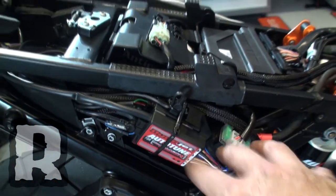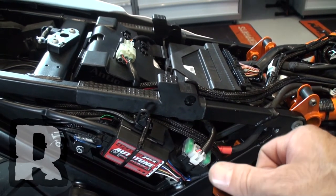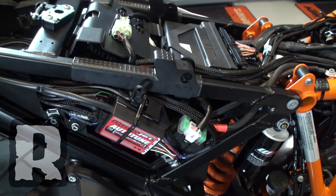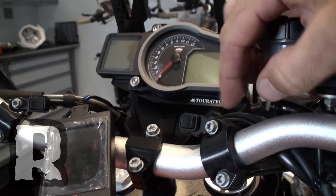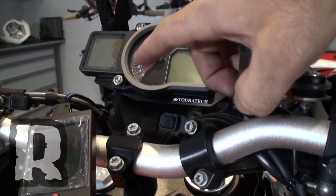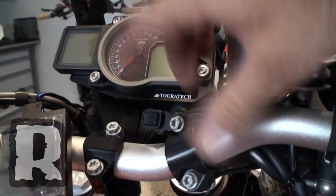Now we've got the auto-tune. Everything we have on here: we've got the Power Commander 5, the auto-tune, a map switch for switching between maps or switching auto-tune on and off, a quick shifter, a wire going to the front for speed sensors, and an extra cable run to the handlebars for switches and the LCD. We run an extra switch for the quick shifter so we can turn it on and off — sometimes big boots accidentally bump it, so when you're off-roading you can disable it, and when you're in touring boots you can leave it on.